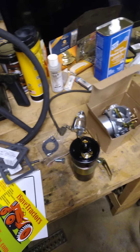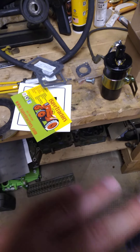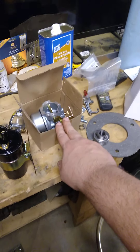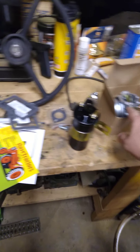Resurface the head, replace the head gasket, replace the carburetor if the old one is really gummed up — these are easy to rebuild too and not expensive. Points, condenser, spark plug wire, coil — that's pretty much it. You've taken care of the fuel delivery system and the ignition system. Get the fuel sediment bowl and an inline filter to keep the fuel clean going into the carburetor, and these things should run every time.